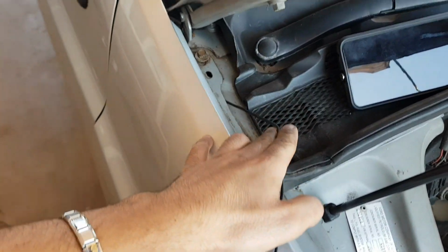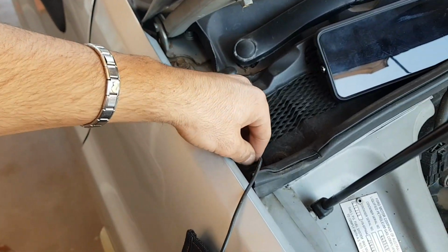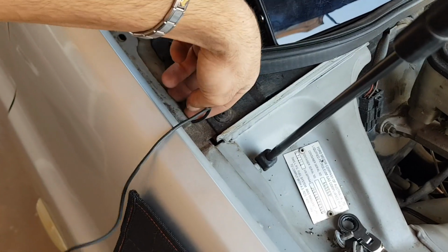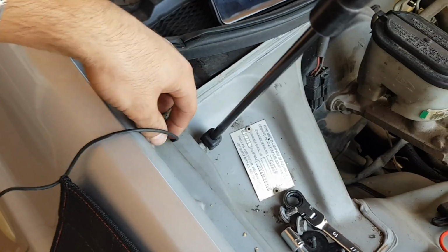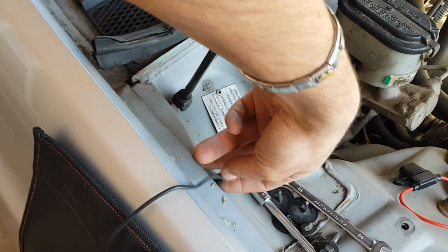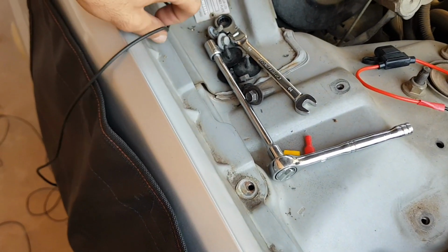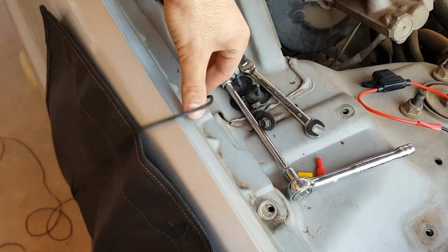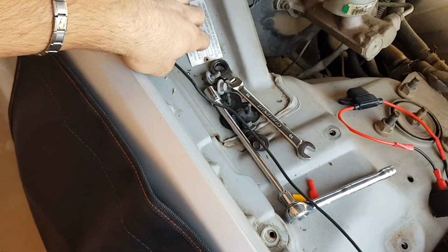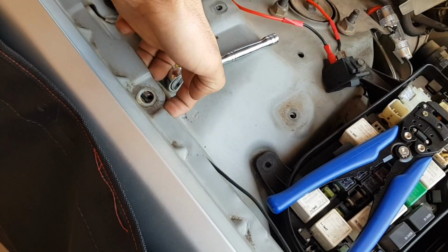So here, I just started tucking the cable from around this hinge section, removing all of the excess and starting to actually tuck in. I've removed this little weather seal and start to tuck in the wires underneath the guard. Just very simply, by fingers, we're able to tuck it so it doesn't shift around, out of the elements. Pop that weather seal back in and continue running this line all the way down the guard. A little fiddly one-handed. Thanks for bearing with me, guys. Just be careful for sharp edges. Don't rush like I did.